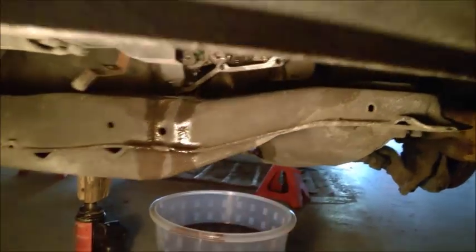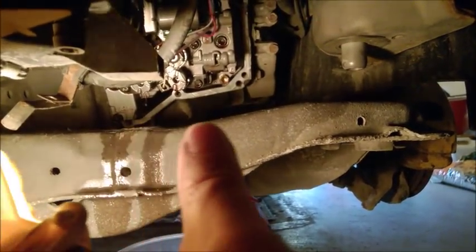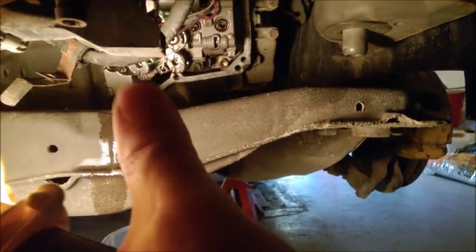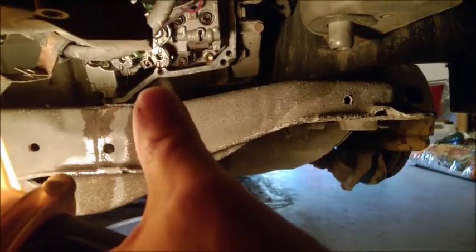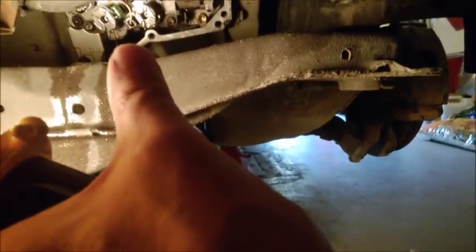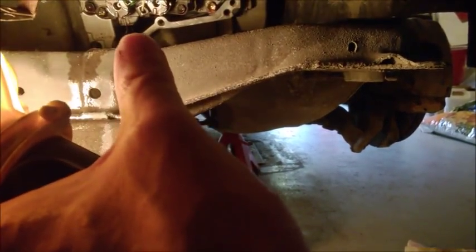And the second tip is that at the bottom you will always have a little bit of fluid leaking. Even though you spray some brake cleaner and clean the mating surface, the moment you actually press the cover on it, it's going to leak again. So place a little bit of paper towel underneath, right in those holes, to soak all the fluid that's in there right before placing the cover.